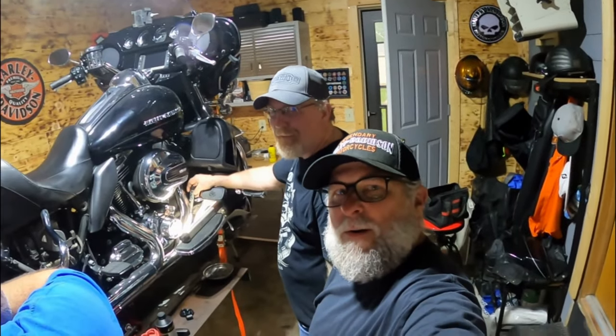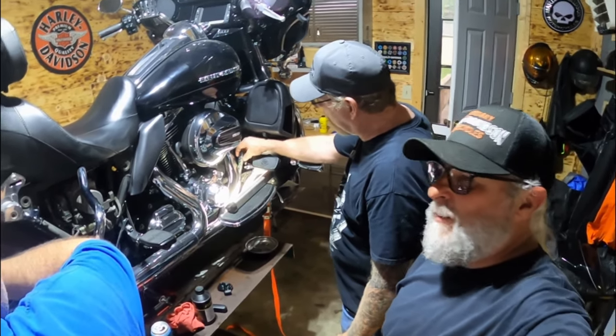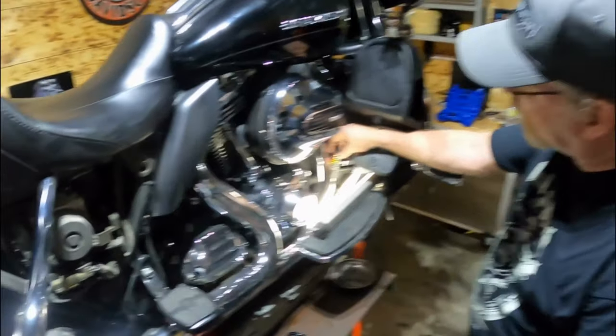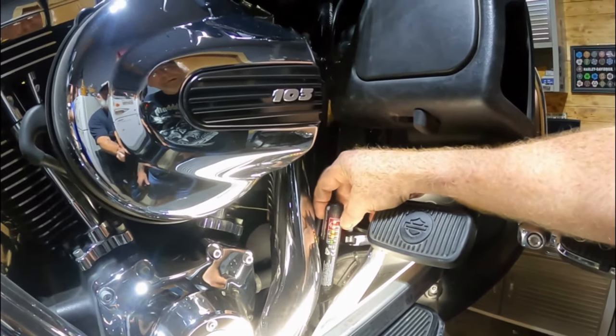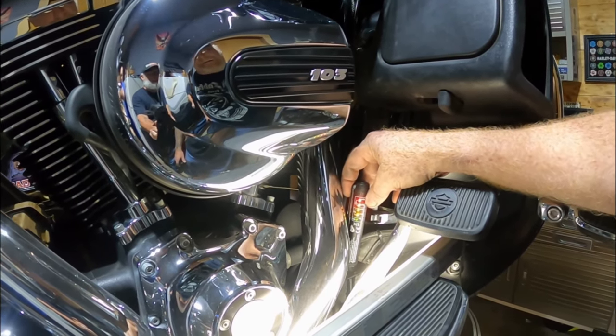Just got the brake rotor on. Now we're looking to test the brake fluid and get that flushed out clean. Neil's also got 4% moisture - that's bad. He joked about adding water to it last week.